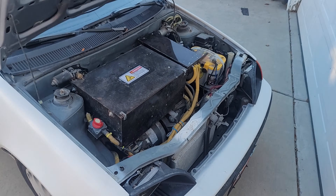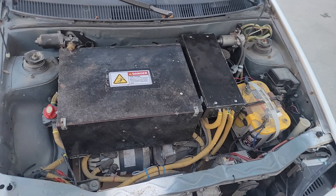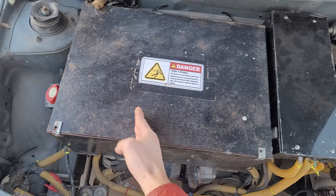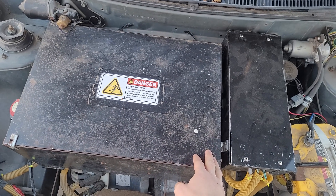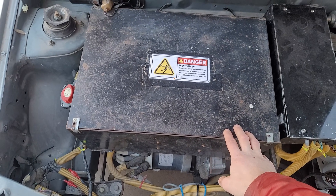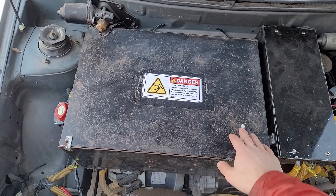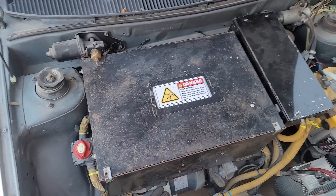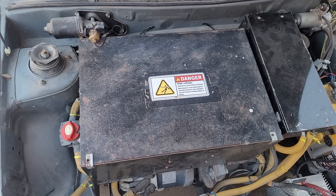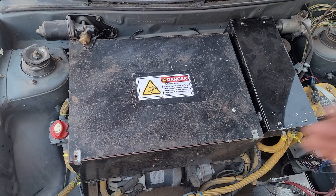So I popped open the hood — obviously it looks a little different than the stock GeoMetro. This here is half the battery pack; it's 14 Nissan Leaf Gen 2 cells in series. So theoretically it's like a 120 volt, 120 amp hour pack — about 13 to 14 kilowatt hours. But I tested the worst cell and it was at about 75% state of health, so realistically it's like 9 or 10 kilowatt hours usable. On this car that gets a range of 40 to 50 miles.